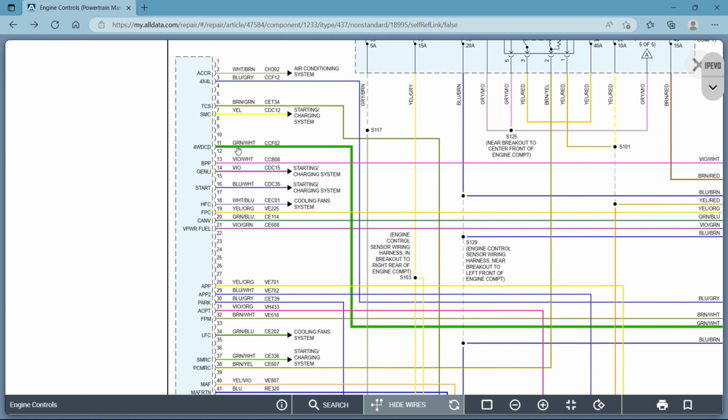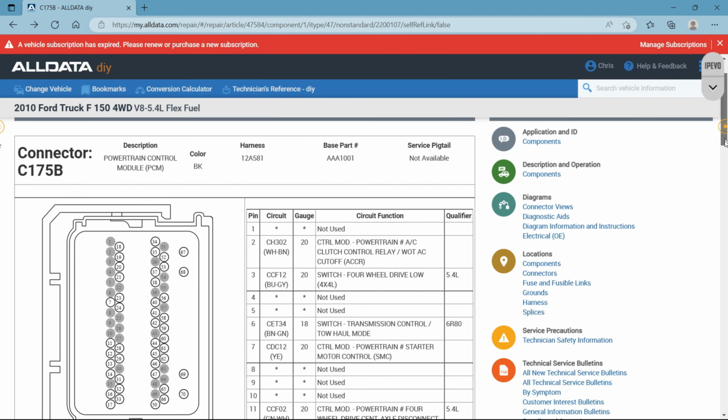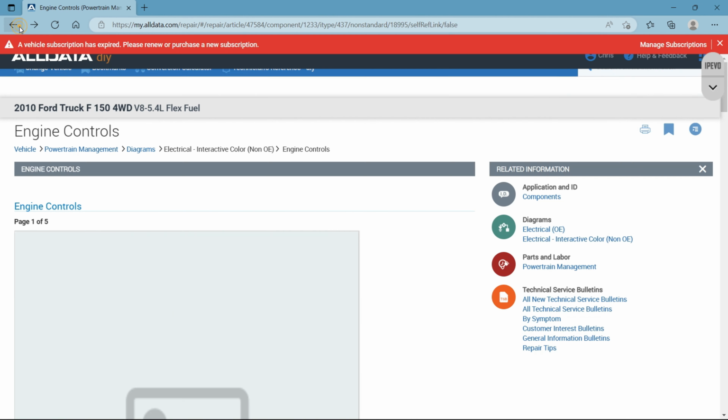So don't go 100% certainty based off of this coloring. But if everything else aligns, if the circuit number aligns, the pin number aligns with what you're looking to work on, so we'll go forward a little bit, and that's a 4-wheel drive. I didn't really see too much of what they were describing here, so let's go back a little bit and see. Okay, so pin number 11, we know it's right because we just saw that number and we just saw the green and white. So it's a control module, okay, for the 4-wheel drive. So right there, it just describes everything that you just saw in the description of that component, okay?